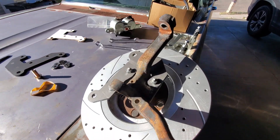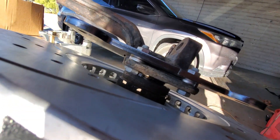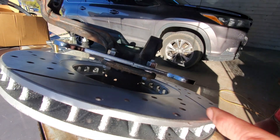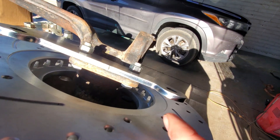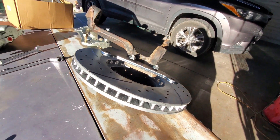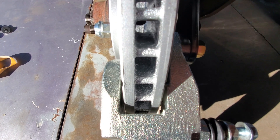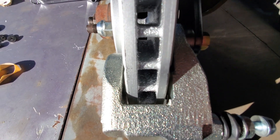Here's the back side of the spindle with the bracket on there. There's a spacer that goes between the back of the spindle flange and the bracket — that's there to raise the bracket off of the casting, because not all of these are cut the same. They machined the depth from the back, so even though the casting may be different sizes, this tries to get it up and off there. There's also a spacing alignment issue I'll show next. The caliper bracket's on, and looking straight down it looks like I've got the caliper bracket centered on the rotor pretty well.